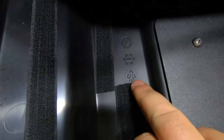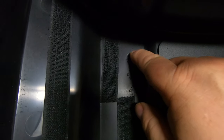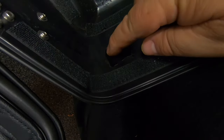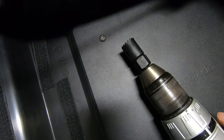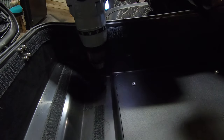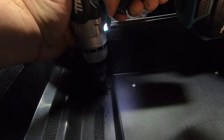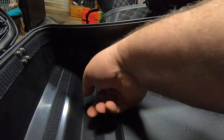Come in here and have a look in the tool pack — you've got one, two, three little stamped discs just there. You want to drill into that one there. It's going to come under your seat, under your tool pack and up under here, with a little grommet that goes in and the wires come through and plug in. I'm using a little hole saw here, drill it out and punch it through. Just tidy that up with a little file and you'll be fine.